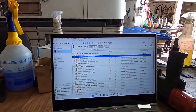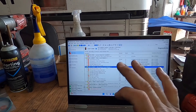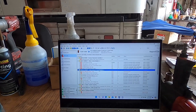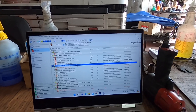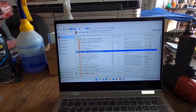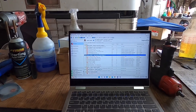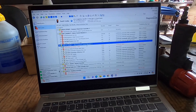I'm going to go back to the truck and pull off the fuel filter — the smaller one. Remember, you have two fuel filters: the larger one on the engine block and the smaller one. Pull the smaller one off, and if you see any kind of metal debris, any shiny shimmery glitter-looking stuff — stop. More than likely that pump is no good and you've got to replace it.